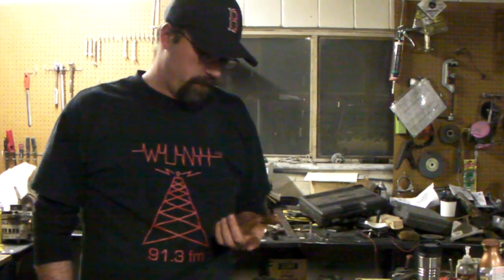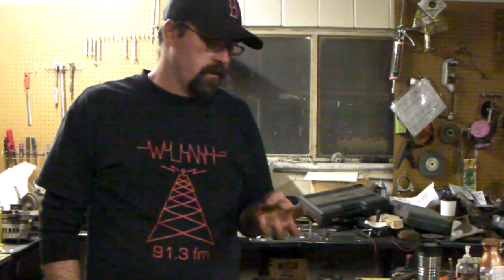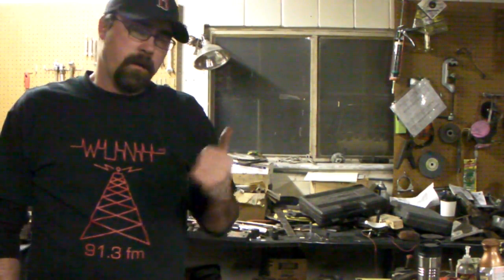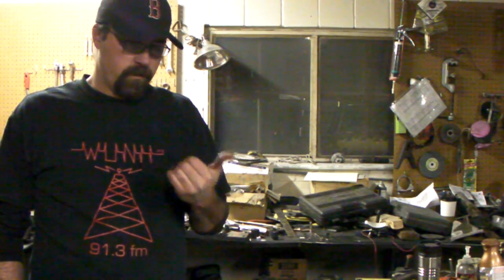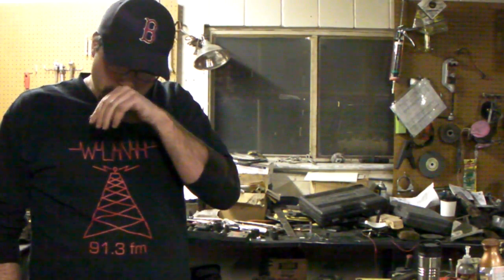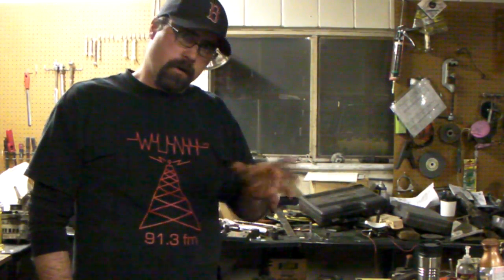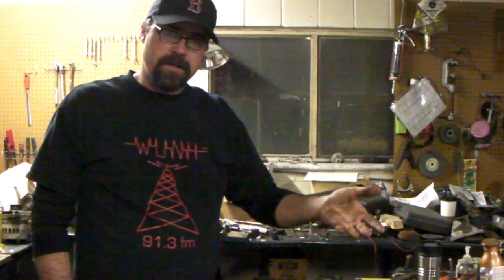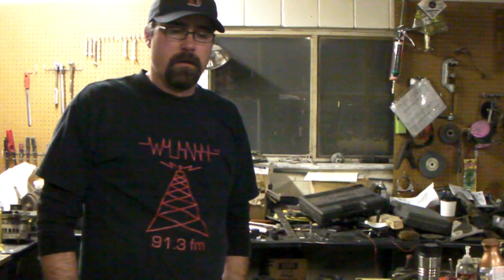Like I said, the things you're looking for: sharp edges, foreign material, metal shavings, spalling. Those are the 4 main issues that you'll run into. And then your pinion yoke. But you'll be able to tell if your pinion yoke is loose just by the way you drive. If you let off the throttle and there's a long coast in between acceleration and deceleration, you feel a clunk, chances are really good that your pinion is loose.